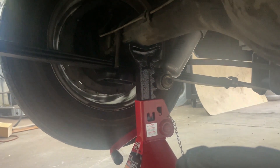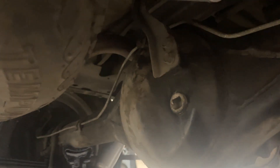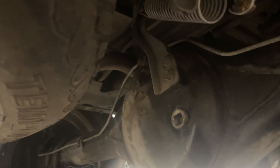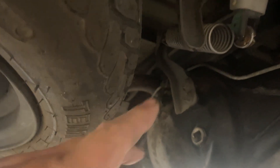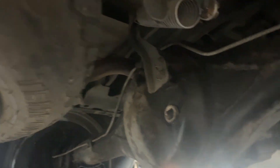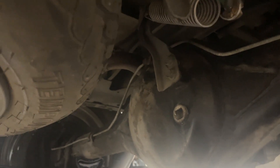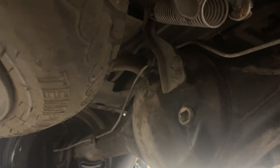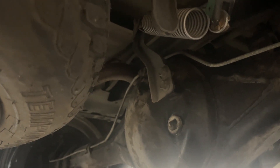Because it's jacked up with all the weight on the axles, so this would be like the right height — but I need to make the normal height and this height the exact same. Because in its mind, it thinks it has a heavy load on it right now, since it's three inches up more towards the truck, which is going to throw my rear braking off. It's not going to act like normal. So we need to address that first — this is probably going to be a long video. Hopefully not. Please stay tuned.